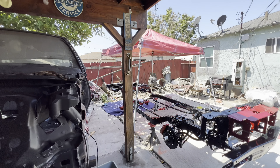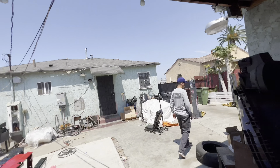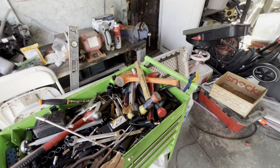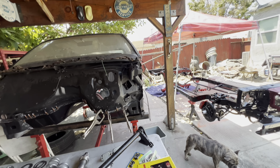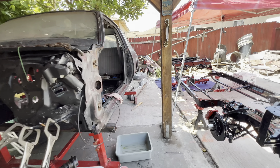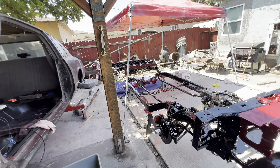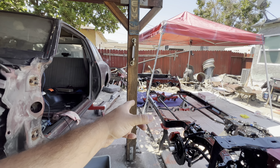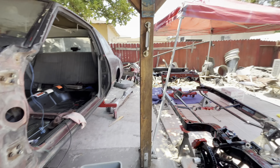That's it, we're gonna bring it in as we go — it is hot today. We're gonna go as far as we can on the rear end because we're still missing the axle seals. We don't have the center section gear yet — the center section is here but not the gear. We're gonna put the brakes on and fully mount them to the differential, but the rest is just gonna be hand-tied in just to mock things up.